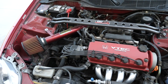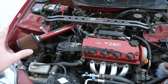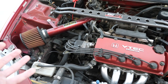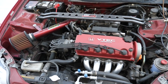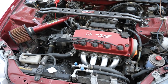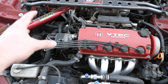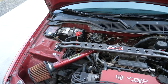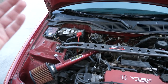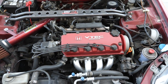As you can see there's a fine layer of dirt on pretty much everything. It's not as dirty as the white Civic, but the lighting isn't really doing me any favors - the camera's not picking everything up. You'll have to trust me when I say it is dirty. First things we need to do: we're going to mask off the intake filter, mask off the distributor with a garbage bag, and also mask off the battery. Even though I know what I'm doing, I'll mask off the battery just for you. Then we're going to fire up the pressure washer and jump into it.